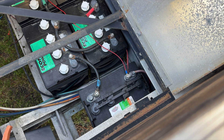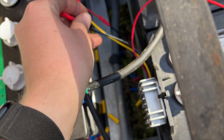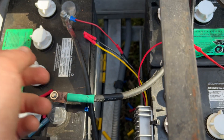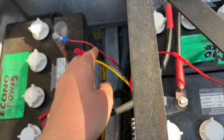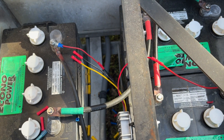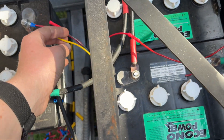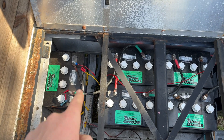We've got that installed — now we just have to wire up our 12-volt accessories. Right here we've got the negatives on the black wire, and the yellow wire is the positive. All you have to do is take the wires from your headlights, turn signal kit, horn, backup beeper, light bar, or whatever accessory you need 12 volts for and just tap into these. Anything that requires 12 volts should run safely off of that reducer.